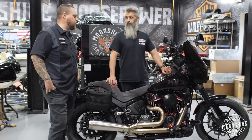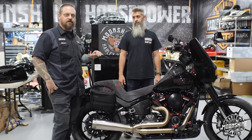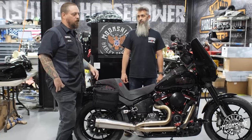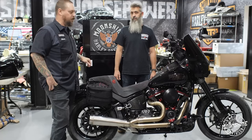Most Harley riders, even when they're riding fast, will shift around 5,500 to 5,800 RPM and think that's about the most the engine could handle. This one, we've got the rev limiter set at 6,700, but it was still pulling when we got to 7,000 and we were like, okay, just shut it down — we don't want to keep going. But it was still going.